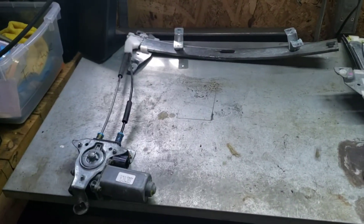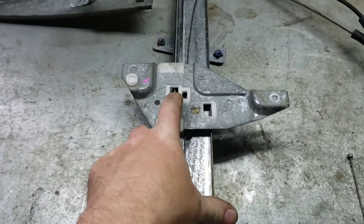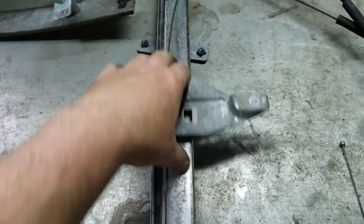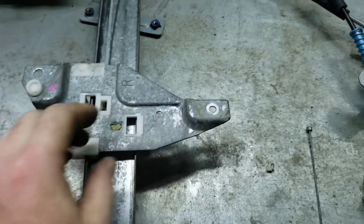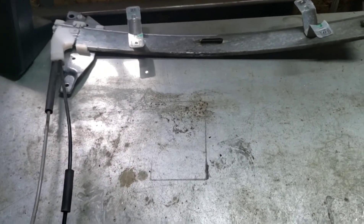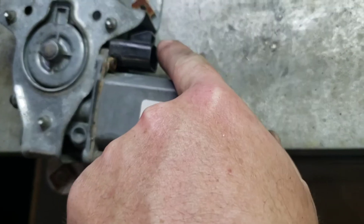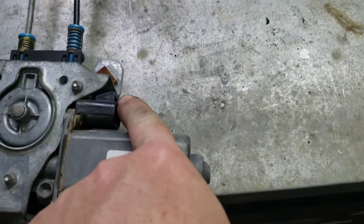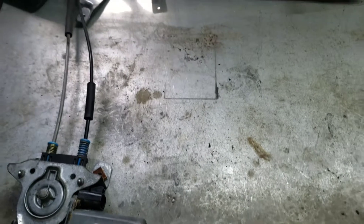I've removed the bad motor and also the one from the parts car. The reason this malfunctioned — the motor itself is actually still good — but there are plastic clips that the window rides on, and what happened is one of the clips is broken so the cable isn't retained, it snapped off and gone wrong. The parts car unit appears to be in good condition — all the cables are tight. I'm just going to lubricate up the track and reinstall it. There's a little plastic clip that ties onto the top, and then you'll see another blue one on top of it. You don't need to undo the blue one; simply use a pick to stick in here and that will pop the wiring harness loose.